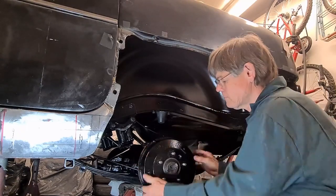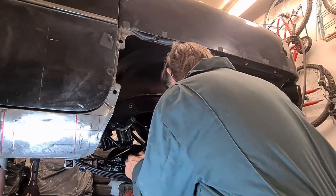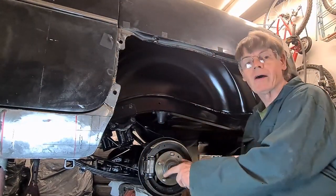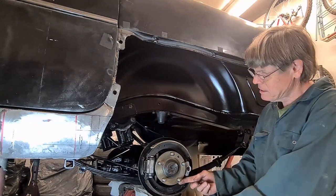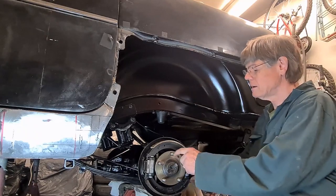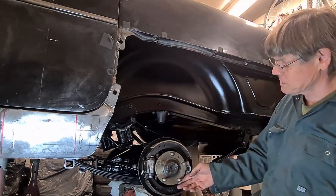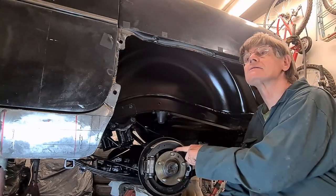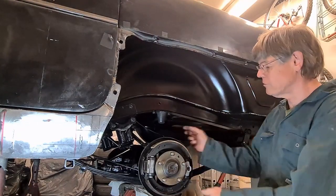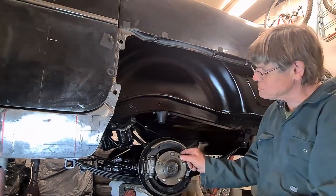The reason I did those up tight is because there's a gasket in between the half shaft flange and the bearing carrier, and I've put some seal around there, so I wanted to keep it nice and tight so it seals. The reason that gasket is there is because the oil from the axle could make its way along and seep out here, so it's quite important that those two parts are sealed properly.